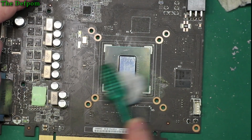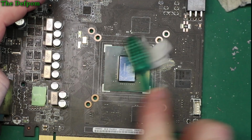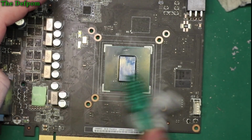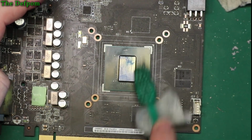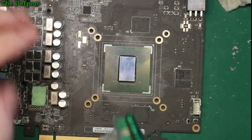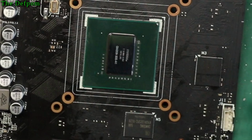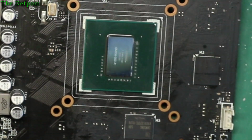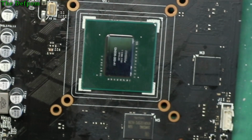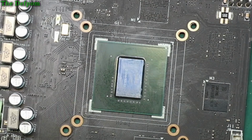Right, so I think there was an Arctic Silver, I think it's one of them. It's got conductive parts in it, so you have to be careful about not over applying it. I think it's that one. Probably some others. We actually have metallic compounds in the paste to make them work better. And now you can see all the components in there, those little dots. Which is why I'm saying you have to be really careful about not scraping it or anything like that. Okay, so that's that part.